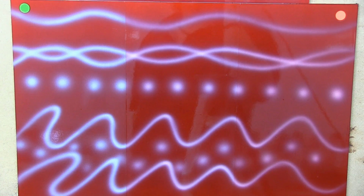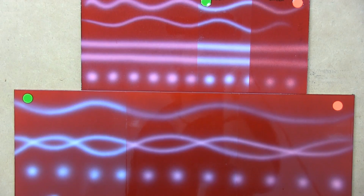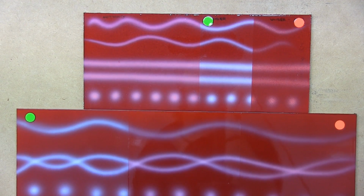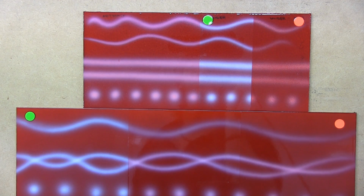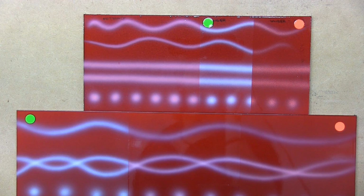Now, you remember I put 10% actually into the candy? You see the top panel here? I didn't actually put my 10% 40-30 into the candy. I just used reducer. And again, you see the whole thing has exacerbated. Look at the white again, absolutely crystal clear. But if you look how much candy bleed back has occurred on the right hand side, that's because there was no 40-30 in before the artwork went on.